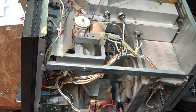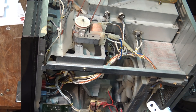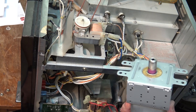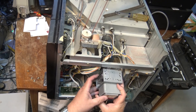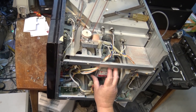Wait a second — not the same. They're different. It's 90 degrees off. They've shipped the wrong magnetron. So I have an old magnetron here that came out of one of my old microwaves that I scrapped. Let's try my magnetron.